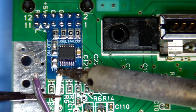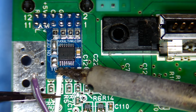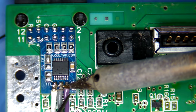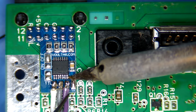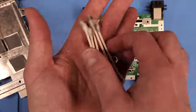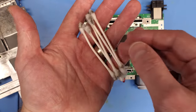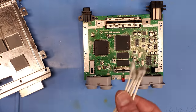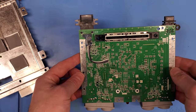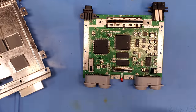Really all we need to do is run the conductors up into the pads over here and solder to the RGB lines. This is pretty simple stuff — just go in, pre-tin everything, get everything tacked into place, and then make my final joints. All of this is pretty basic stuff; it's just a matter of taking your time, making a nice solid joint, and you should be good to go. I spent a bit of extra time cleaning up the shielding after the quick wipe down, and I'm really glad I did because that thing's absolutely disgusting. But anyway, let's get this thing put together. Everything's looking good on the RGB mod, and it's nice not having to install the sync line, so we'll get this thing put back together and then it's time for that new case.